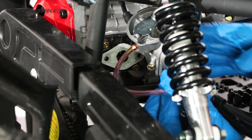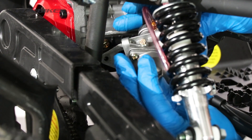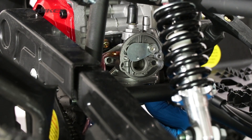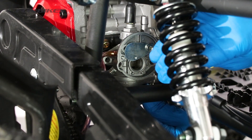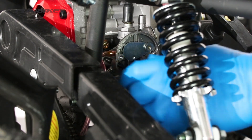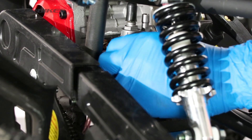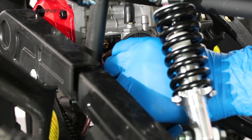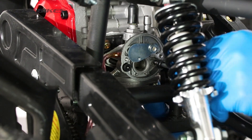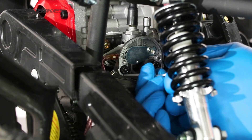Once you are happy with this, you can then reattach the carburettor to the bike. Check the position of your gasket and make sure it is not damaged — if it is, it will need replacing. Align the carburettor into the correct position and using the two screws you removed earlier, slide them back through the holes and tighten up. Only loosely fit both sides at first and then equally tighten both sides, doing a quarter or half a turn on each bolt once they start to become tight. This will avoid damage to the carburettor, either bowing the plating or cracking it.